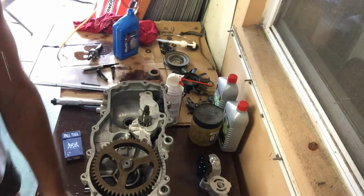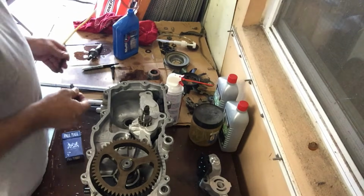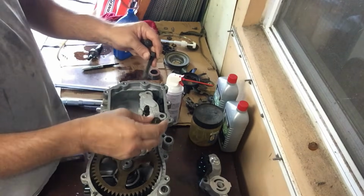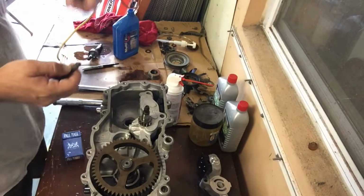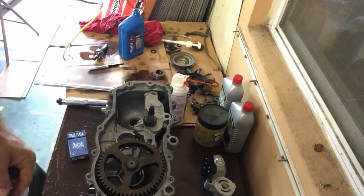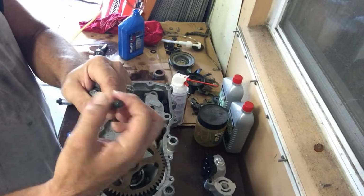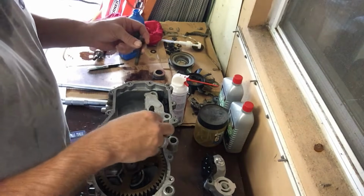So not too difficult. And in terms of doing this the right way, I actually did refer back to the Hydro Gear website again, just to see if there was an easier way to do this, and the easier way is the correct way. Once you have the center section piece and your shaft in, that's when you install the center section bolts. If you are reusing bolts from the old center section that you took out, which you shouldn't have to do because these bolts come with the center section replacement, you should get some thread locker. They already come with a thread locker from the manufacturer. Get some thread locker and put that on there. You're supposed to use an anaerobic thread locker for that. So that's what we're going to do next.